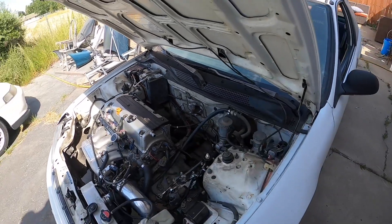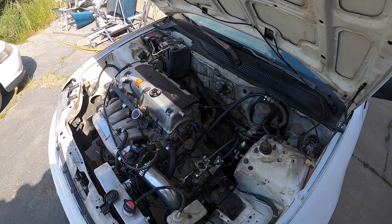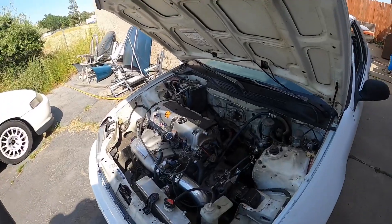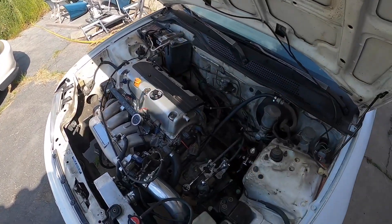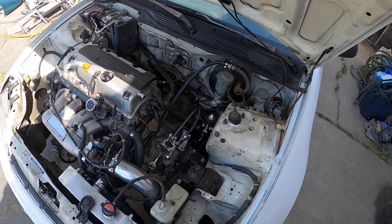And a Civic Hatch EG does, when I thought all along everything is mirrored between the two chassis. So yeah, let's figure it out. For now let's go get this car jacked up in the air and pop the axles out. I already got the replacement one for the passenger side, and what I'm going to do is swap out the driver's side cup to the passenger and vice versa, and put it back on that way.